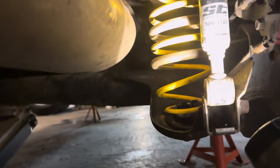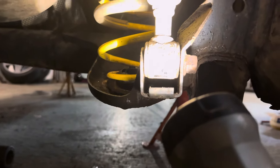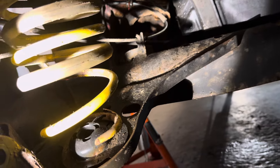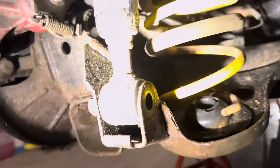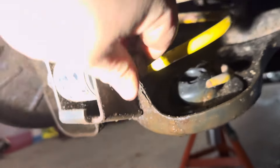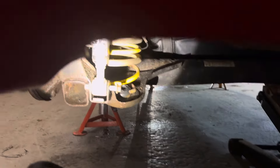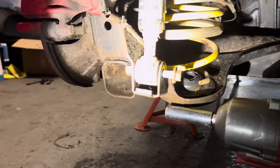There are some rubbery foam sections — I think Powerflex does a replacement so I might look into that. All we need to do is jack the axle up until the bolt hole lines back up, because obviously these coilovers are shorter than the standards. Get that through, thread it in a bit, and then we'll have a look. Head over to the other side, same again — throw that in a bit, make sure the threads have caught and then we'll get the gun, wrap them up and that's the rear done. You've got to torque it to spec, obviously — so you take Bertha.